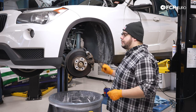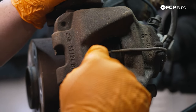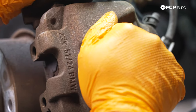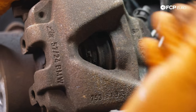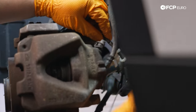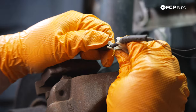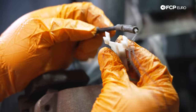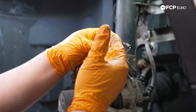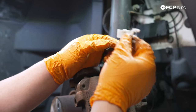We'll start by removing the sensor from the brake pad — it really only goes on one way, and the sensor is always on the inboard pad. The light has already been triggered on the dash so we know it's bad — it is completely squished. Following along the back, there is a white clip on the metal crimped portion of the soft line. As you can see this one's not in bad shape but it broke as I removed it — that's the problem with these, they get brittle and are really only one-time use. Note the orientation: the clip has a small slant, with the top slanting toward the inside of the wheel well and the bottom slanting toward the brake caliper.